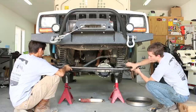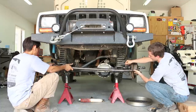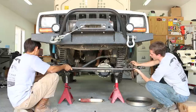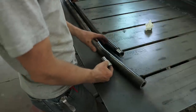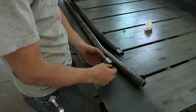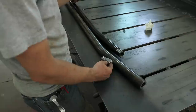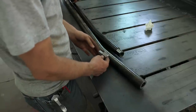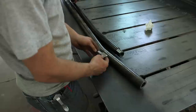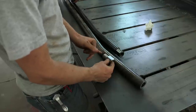Once you have your tie rod ends in, we're holding everything into place and getting an idea of where we can cut the excess off. These weld-in bungs that thread onto your tie rod end will insert inside of your DOM. Once you get that mocked up, you can tack them in place and then weld them solid. This is the weld-in bung that we threaded leaving one inch to the tie rod end — it's in the knuckle now. I marked where the excess will be cut off; this is where we bent it, about 10 degrees or so. The bung needs to be out far enough from the bend so it can still insert into the DOM.